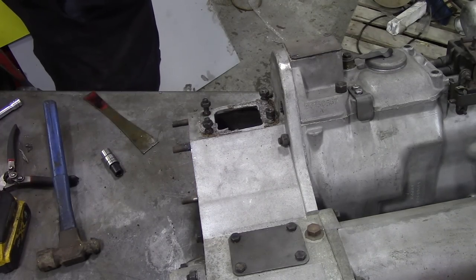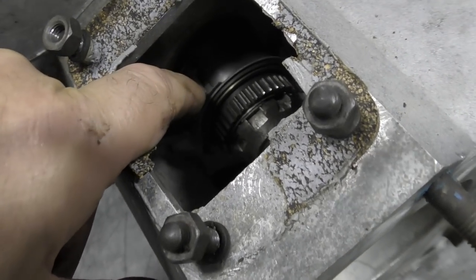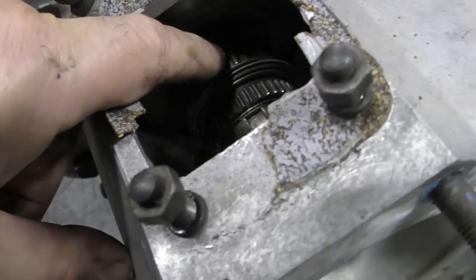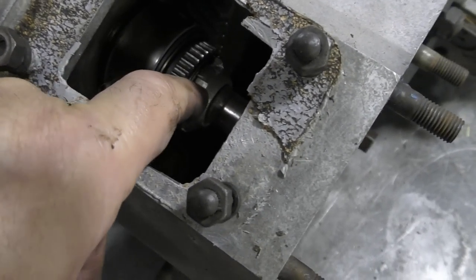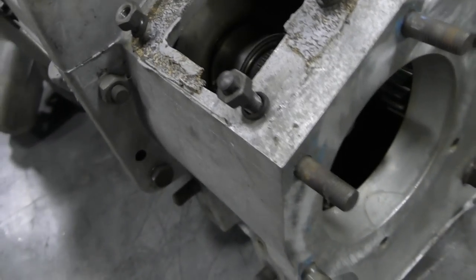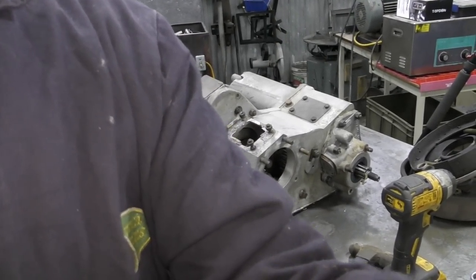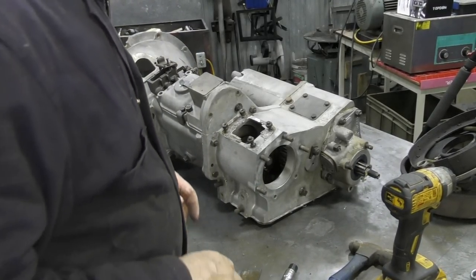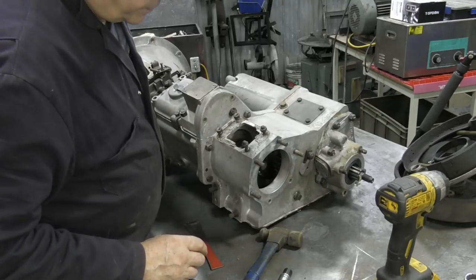Let me take this camera off so you can see. There's no gear on it, but you can see that bearing - it's just split in half. This is on a very fine spline. To take that nut off, I'm just going to use a chisel for now and then we might have to get a new nut or see if we can salvage it. You should have a lock washer on it.